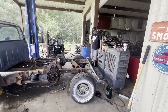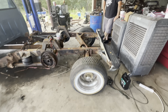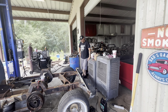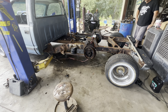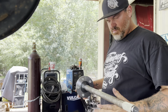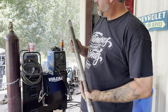I'm in, Dan's out here working on a Saturday. Y'all check this contraption out we came up with — I took the old rear end and welded it under the shackle hangers so I can roll it in and out. New axles came in yesterday, so we're fixing to cut this out of the way, put the new axles in, get the rear back together where we can put those wheels on. Got to get some fittings for the rear airbags today so it should air up and down on shop air today. Got my personal model Dan here to showcase y'all some Moser axles — Street Series, 3 inches narrower than factory, 30-spline — should slide right in with a C-clip.